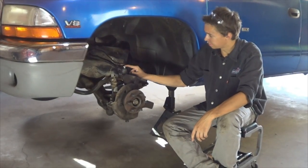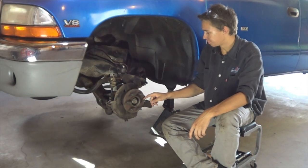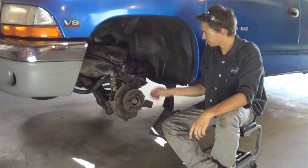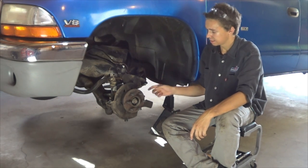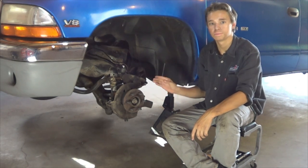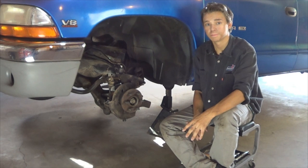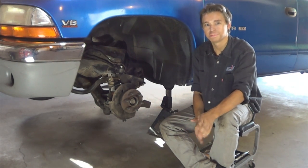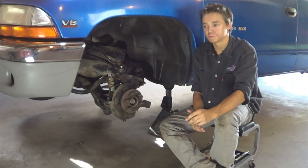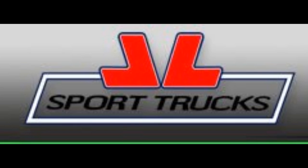Make sure you grease your ball joints and your tie rod end. Put the brake rotor on and clean it with brake cleaner. Make sure your caliper bolts are tight. Put your tire on, put the lug nuts on, and when the vehicle is on the ground, torque to the lug nut specs for this vehicle. You can buy these ball joints from us — the link is in the description. We upload videos weekly, so if you want to keep up with tutorials like this, subscribe to our channel. I'm Chris, see you in the next video.